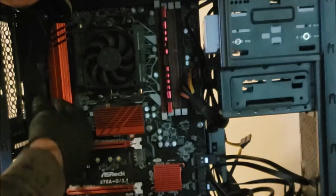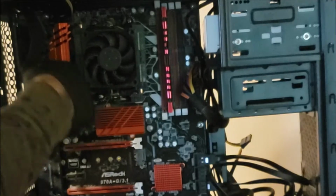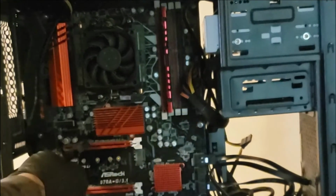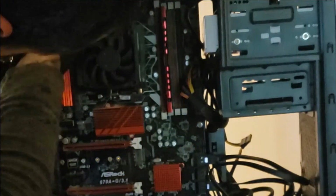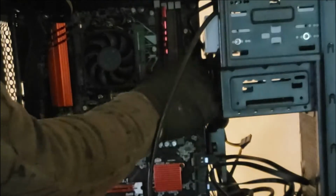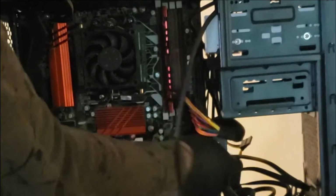So if you're looking, guys, we got plenty of room here. We actually got this USB 3.0 cable hidden on this heatsink. So let's go ahead and do away with this and unplug it, just like so. Okay. They just got it running across the top. Yeah, that's out of the way. Go ahead and unplug the 24 pin. The SATAs, like 2 of them.